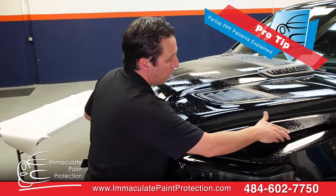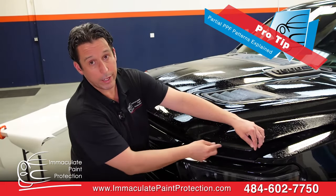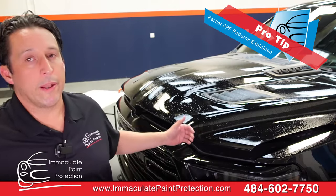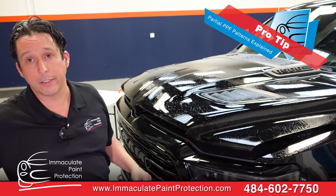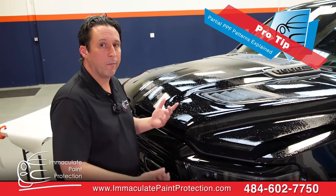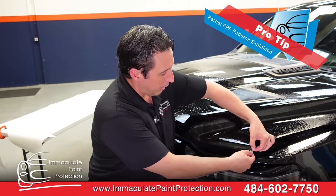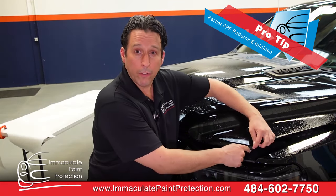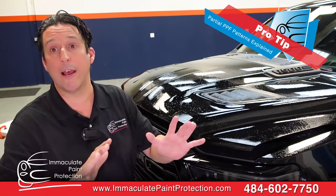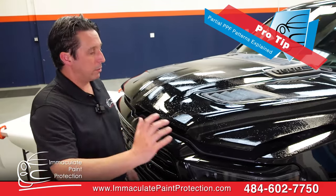The pattern has the option to either wrap the edges. If you don't wrap this edge here, you'll see it get chipped right along there. Why would we roll that edge? It takes a little extra time — we have to wait for it to dry and get under the rubber gasket — but it's a better install. That's our shop policy: if we have the option to roll that edge in, we will. You will see an exposed corner right in the corner — it's just impossible to wrap material around there. We wrap as much as we possibly can.